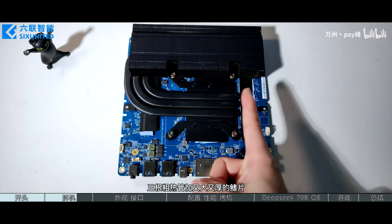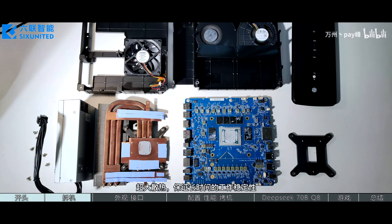Internally, the AMD Ryzen AI Max Plus 395 is attached to a base plate with three copper heat pipes leading into a larger heat sink with several aluminum fins. The motherboard features at least 23 power phases, and the Strix Halo APU is surrounded by 8 DRAM modules.